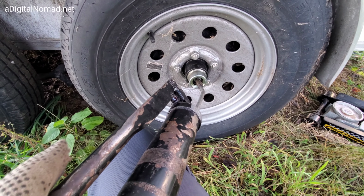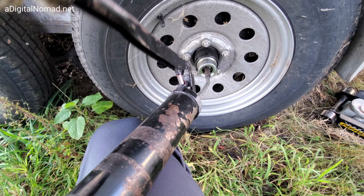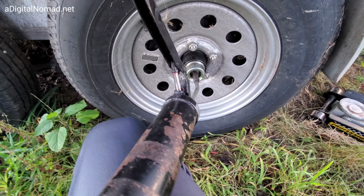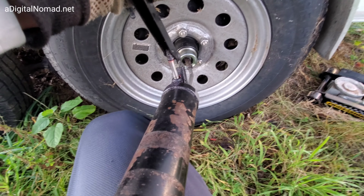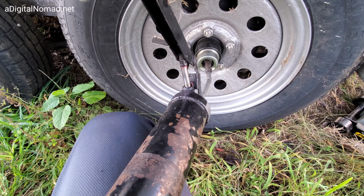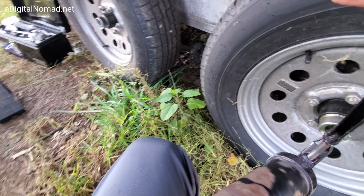All right, let's go over how to change a cartridge out of a grease gun. Cheap, easy tool. You know it's empty when you're going like this and almost nothing happens. See, there, we're out. So, what's the easiest way to do it? First of all, open this and then twist this barrel off. You gotta grab it with your hand and twist. All right, you see, should be able to turn it now. Keep this arm up the whole time.